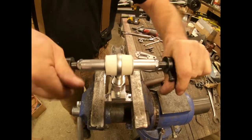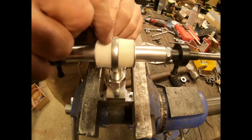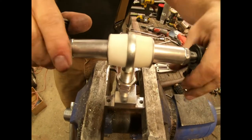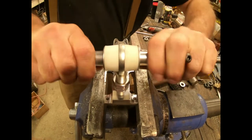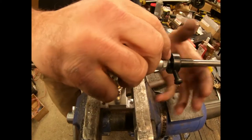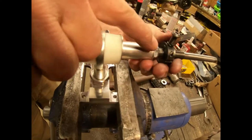We're going to set the back spacing on these next using a micrometer. A good starting place with the bushings is to close the gap up in here — just close the gap up and that's a good place to start with the bushings. It'll also get you real close to the right amount of gap between these two. Spin the axle until you see the slot — each side has a slot in it. You can see the flat spot right in here and you want to line that up, then peel that back in.